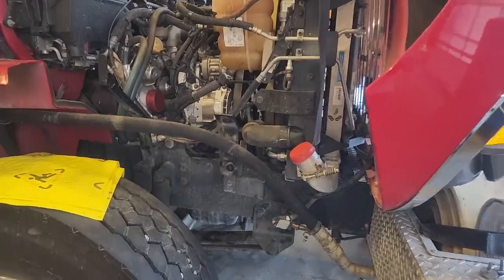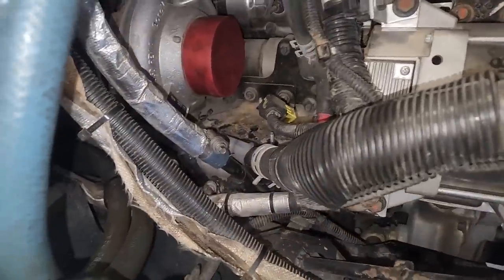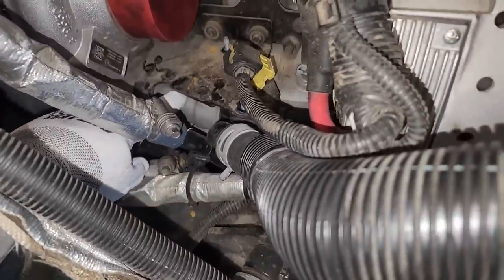We got that fire truck. Need to figure out how to test the EGR system and determine if the coolant's coming out of the cylinder head or coming out of the EGR cooler. So here we are at start of the day and we're trying to pressure test the EGR cooler, which is this huge aluminum housing right here - that's your EGR cooler.